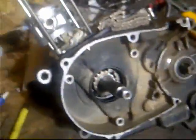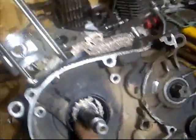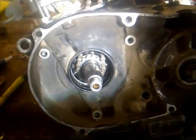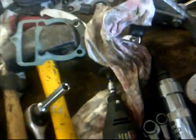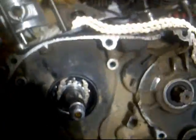Just wanted to shoot a video of this XR100 motor that I've been rebuilding here over the last week and a half or so. Basically I found out the timing chain was bad, and the lower gear was actually really really pooched. Here's the old one — you can see the throwing star nature it's become. The top gear is also the same. Apparently this is a problem with the XR100 — the timing chain.